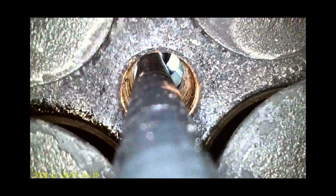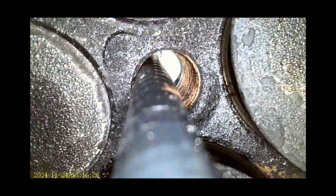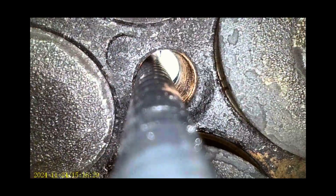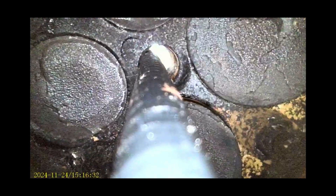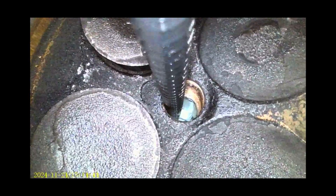This engine has 200,000 miles on it and the amount of carbon is pretty unacceptable. Between the valves the valve seat looks good. I was rotating the engine to get a better view of the inside of the valves — didn't look like there's a lot of build up there, which is a good thing, but this much carbon is a problem. In the lower right-hand corner you can see the direct injector, which was fairly clean. The piston's dirty but the crosshatch looks good. Compression is impeccable at 160 per cylinder, but all this carbon is definitely performance robbing.